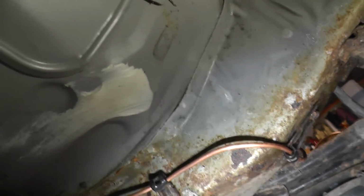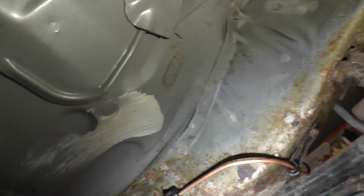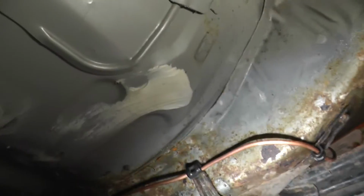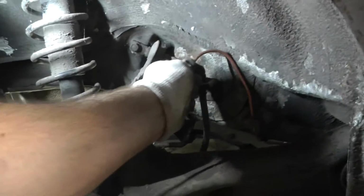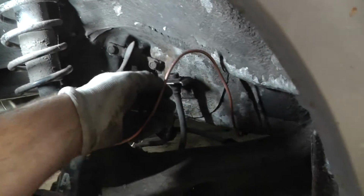So now I just need to go finish underneath the car here, and I'm just gonna put the flare in and attach it to the rear drum. Then I need to bleed the brakes. First of all, I just need to cut the brake pipe to size. So that will probably be about right.